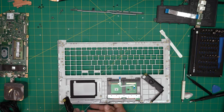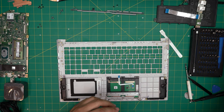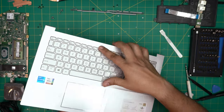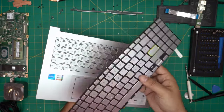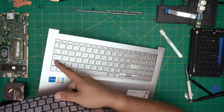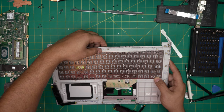The speakers will be wobbling around, so don't worry — they are not screwed down but have vibration pads on them. First, present your keyboard right in the same mesh plate to make sure it goes in nicely. Bring it over and put it in. Double check that all the keys are in place — for example, on mine this key was divided in two, but on the US keyboard the shift is one piece. As long as there was no plastic in between them I was fine. Now align it and push through the rivets.